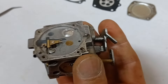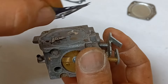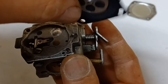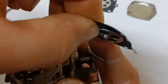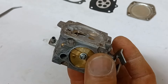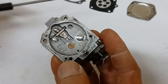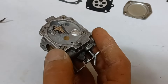When this gets pushed down it should lever up and down on that needle. When we put this back together, this piece right here has a small tab that sticks down — you can see it in the video — that needs to get hooked down into that little fork. I noticed on the old one it doesn't even have that hook on there, so I don't know if they changed designs. It looks like it's just a button to push down. Maybe somebody got the wrong rebuild kit, or maybe the saw has been rebuilt before — if you guys know, leave a comment. The rebuild kit I got was just off Amazon, a cheap rebuild kit, so I'm hoping it works out.